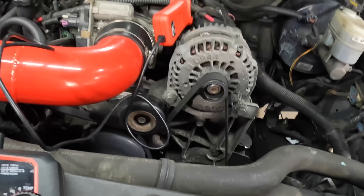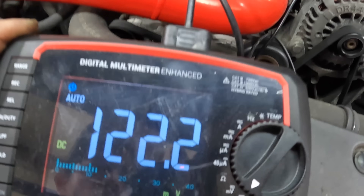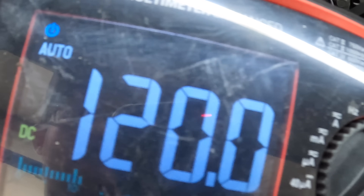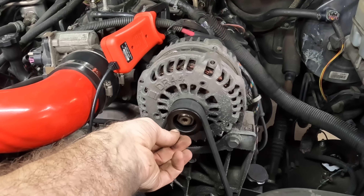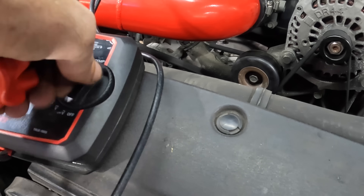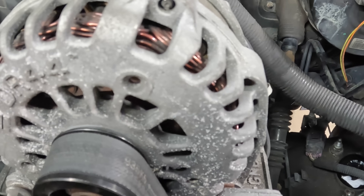Without having to raise engine speed. So what that's going to do is allow us to have more cooling or more power in traffic and in short trip conditions. With the additional fans coming on we're shooting out 120 amps — look at that. Alright darling, go ahead and shut everything down. So that's proof in the pudding right there — a gear change on your alternator in the right circumstances can affect power output, which could ultimately lead to longer battery life.